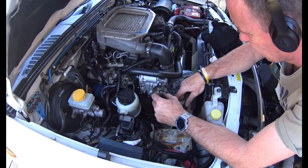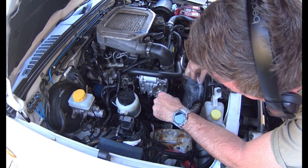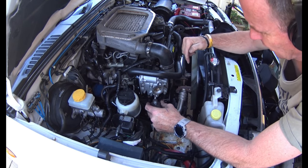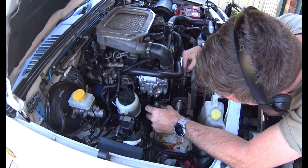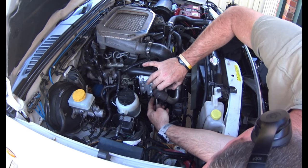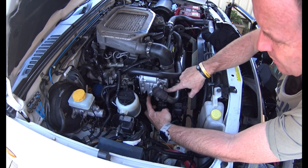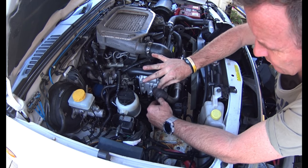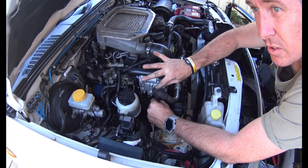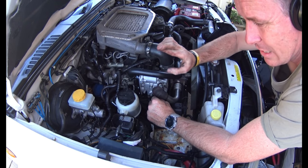I gave this pipe a bit of a clean out too. There's still a little bit of sooty scale in there but it's virtually impossible to get it fully cleaned. The kit only comes with a gasket for the top here - you probably aren't expected to remove the bottom as well, so I can leave the old gasket on there and use the new one for the top. A couple of turns to get the thread started, bottom one in, make sure the gasket's aligned. The four mounting bolts are all tightened up, so it's just a matter of doing these two and the two 14mm nuts. I'll plug it in, put the battery back in, do the factory ECU reset, and hopefully it'll start up without any issues.